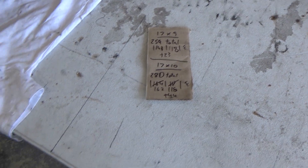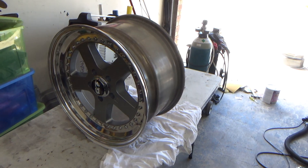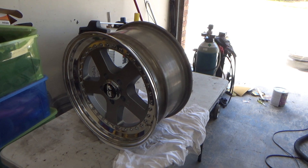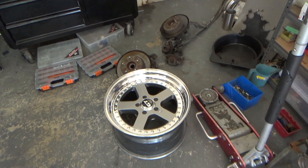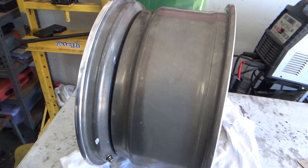We've got plus 23 in the front, plus 44 in the back, which is perfect S-chassis size. Measured off my 13 - could have gone a bit wider, but this allows you to run the backs up and get all the grip you can. Now just have to seal up the middle, mask them off, seal up the middle and we are done.